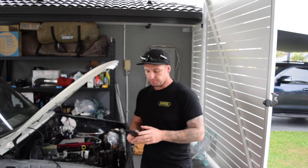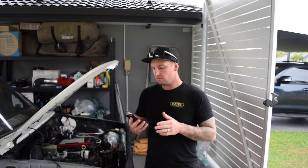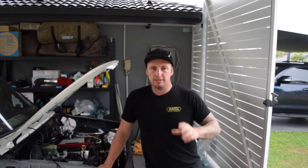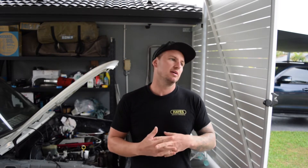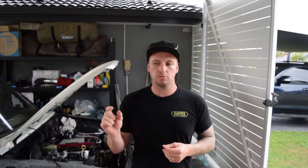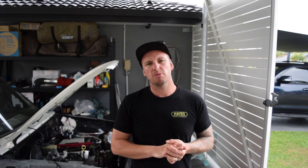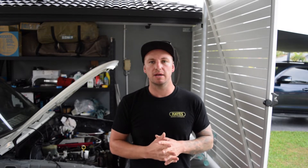The first thing we were looking at at the end of the last episode was the transmission mount and how it wasn't lining up. I got onto V6 and V8 Conversions at Moree — they were helpful at the start, but that's about to change. He said maybe the engine mounts were labelled wrong and the motor was sitting 30 mil the wrong way. I swapped them around to see if it moved it back — it didn't. The engine mounts were right. We're still 30 to 40 mil away from that transmission mount. After a few days of going back and forth, he pretty much just brushed me and said 'it works on ours, don't know what's wrong with yours.'